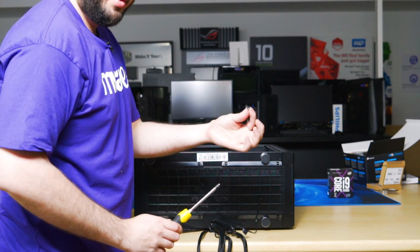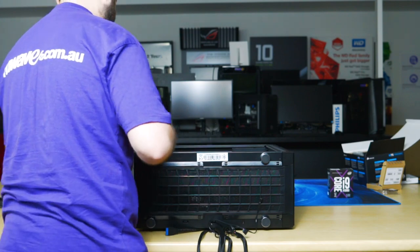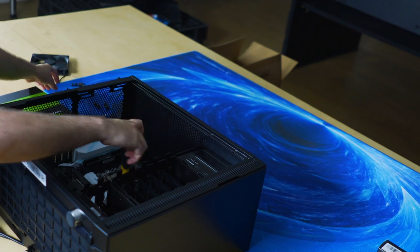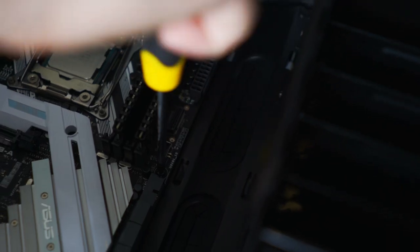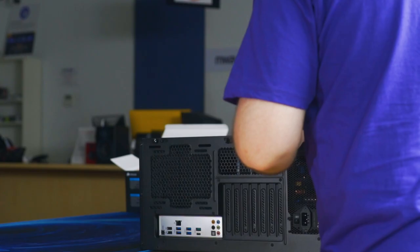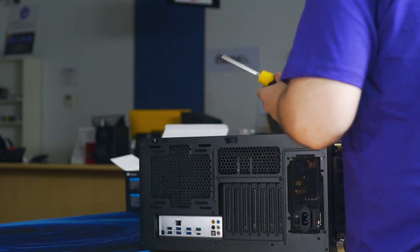there are screws that are labeled inside that accessory box, same motherboard screw. Grab eight of those. Just start with the edge, center edge. Just touch tight. Okay, the motherboard should be secure enough now for me to lift it up so you can see it in full frame.